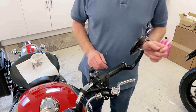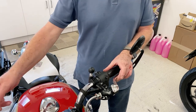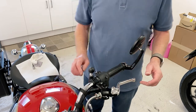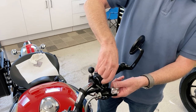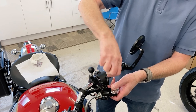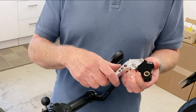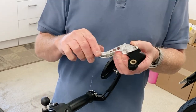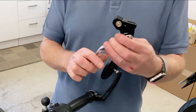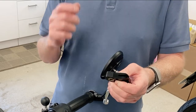Now, if I pull the lever in with the bike in first gear, back she comes. Excellent — she's now back to being like a normal bike. This may be useful to you if you bought the Hitchcock's levers and come upon the same issue. It's a dead simple fix. From positions one and two the clutch switch won't work, but from position three, four, and five onwards it works okay. If you want to use positions one and two, just attach some kind of little pad on that inside surface — that cures the problem.